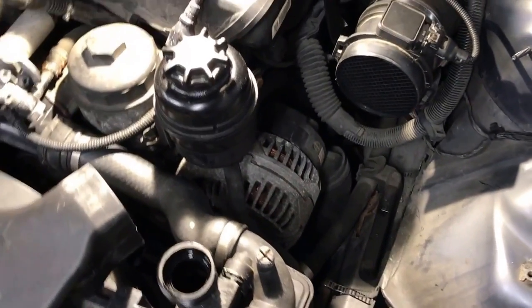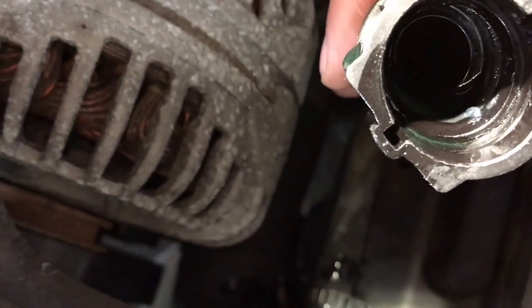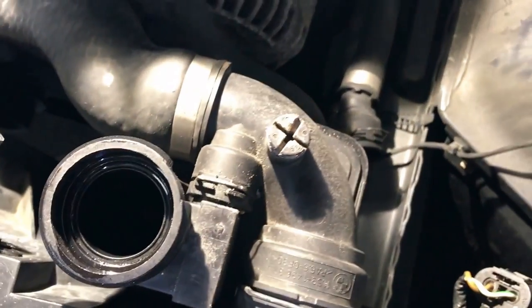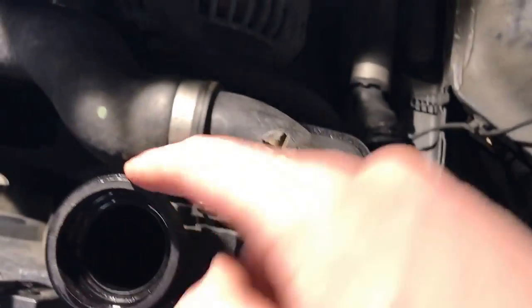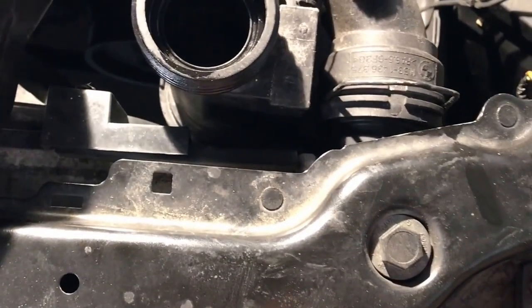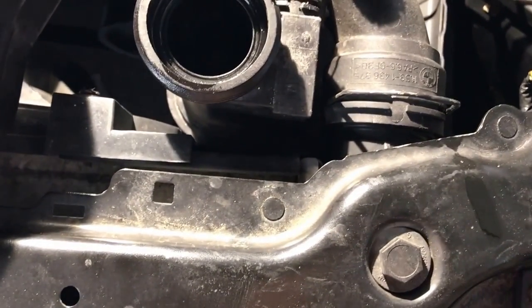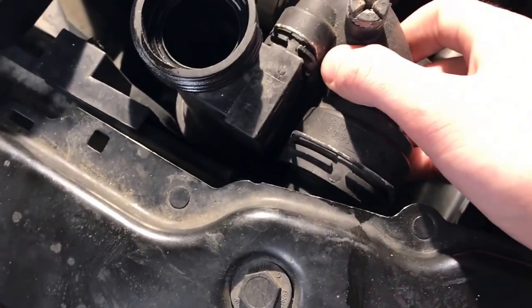Now that you have those clips out, try to pull out the hoses where you just took the tabs off. This one comes out pretty easy — I held the expansion tank and pulled on it and the hose came right out. While you're in here, inspect the o-rings and see what they look like. This o-ring will be the same as the bottom one — I'll have links in the description for both. The other hose is kind of difficult to take out — pull on the expansion tank a little and it rocks forward. I'd recommend using a plastic pry tool rather than a screwdriver, stick it right in between and try to pull it apart, or just wiggle it with two hands.